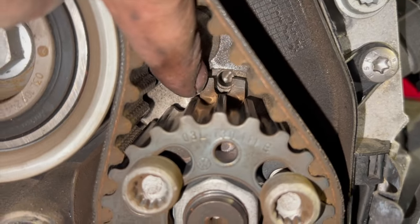It's just locking the back section of it, whereas these are just allowing the outer pulley just a little bit of float, that's all. So just put the pins in the two top ones and then just show you the crankshaft position. Yeah, so just can't get the pins in. I've just locked the actual crankshaft in place at the minute, but it could be that the timing is very slightly out, or just with the belt stretching over time.